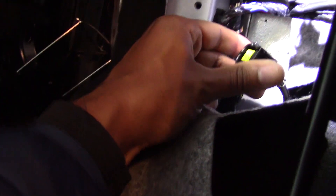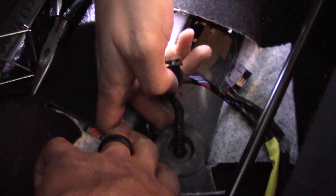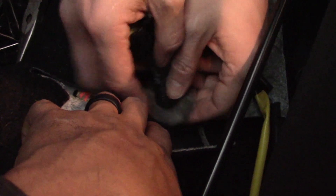There's my finger pointing at it. The plug is easy to remove — just depress the holder clip. Here's a better shot of it removed. There is a grommet on the O2 plug. Your new O2 plug should come with a new grommet; if not, just reuse the original one.